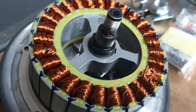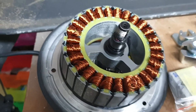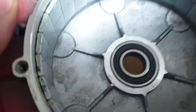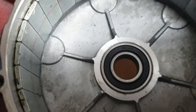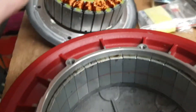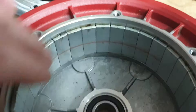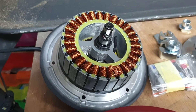This internal part of the motor is not available, so it's just a new motor. Obviously the bearing as well — if the bearing falls apart, it's a rubber sealed bearing. If that falls apart, it starts shaking, the whole thing starts vibrating inside, it starts destroying the magnets, and ultimately that is the end of the motor.